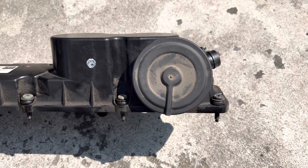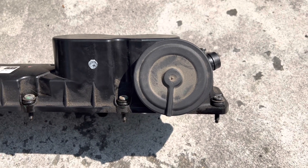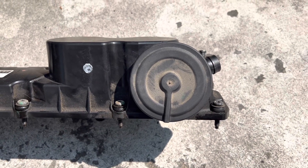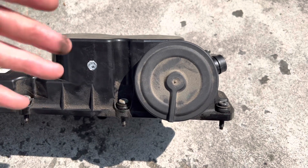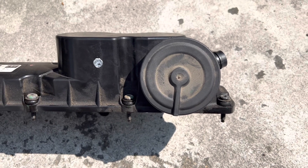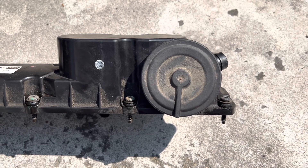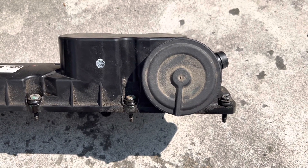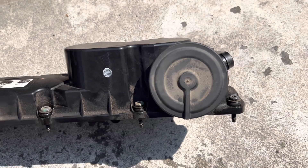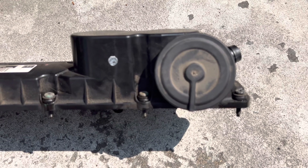There's a MAP sensor in your intake. The MAF would be before the intake toward the air box, and the MAP is after the throttle body in the intake. This car has a MAP — there's no MAF up near the air box, just a MAP down in the intake past the throttle body. You don't want oil getting on there, and you don't want oily intake air getting into your combustion chamber and oiling up your spark plugs.